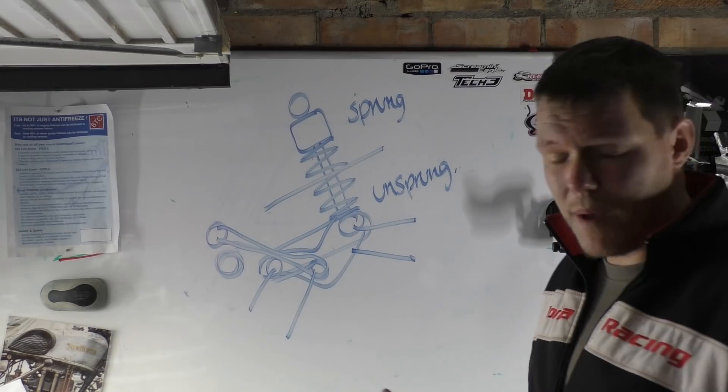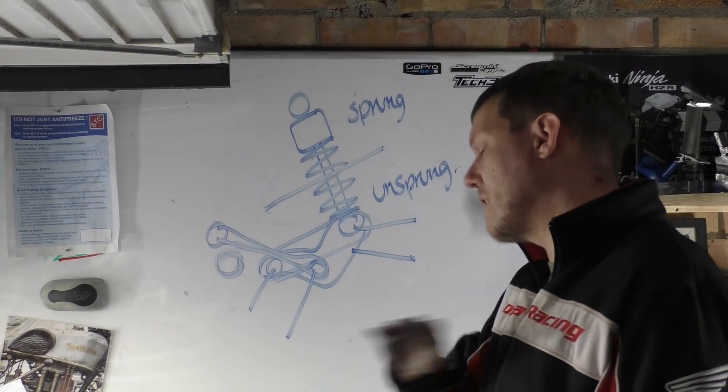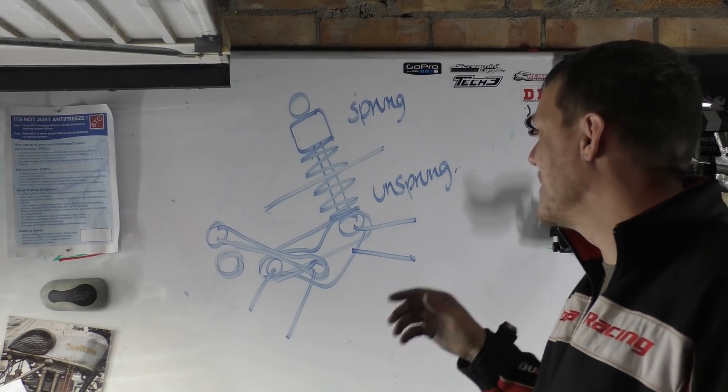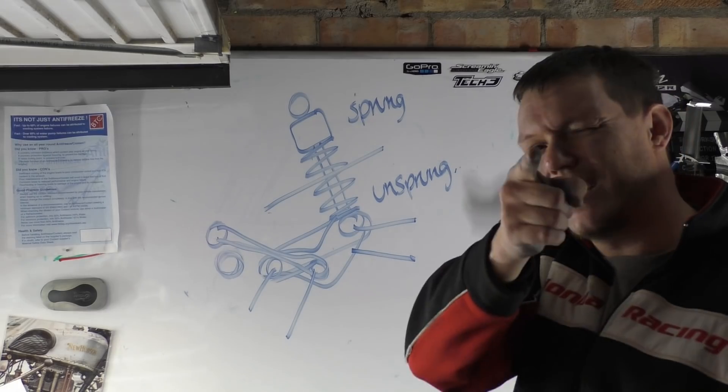People agonising over 30, 40, maybe 100 grams — they really don't care. MotoGP can build whatever they want, and they choose fork stiffness, packaging concerns, and reducing wheelbase sizes over unsprung mass. Hope that makes sense. We'll talk more about gyroscopic effects and the reverse cranking of an engine and what difference that makes. See you in a bit.